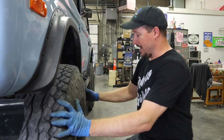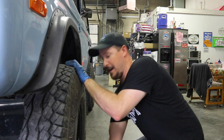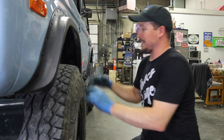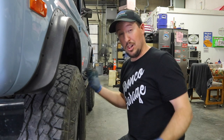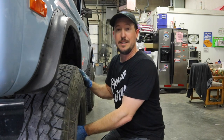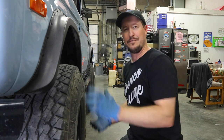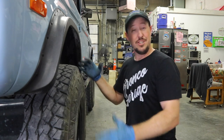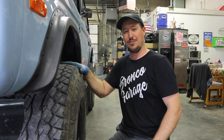To diagnose wheel bearings, let the tire free spin, then grab the bottom and the top and do a rocking motion — pull out on the bottom, push in on the top, and reverse that. What you're looking for is excessive in-and-out movement. A little bit of play is pretty normal, but if you hear a clunk or a significant wobble, there's a good chance the wheel bearings need to be replaced — and possibly even the spindle, though it could also be ball joints. This assembly is nice and firm because we just finished installing the monster disc brake kit by James Duff. Check that video out, subscribe, and leave a comment below — I want to hear what you're working on. Thanks for joining the Bronco Garage, we'll catch you next time.